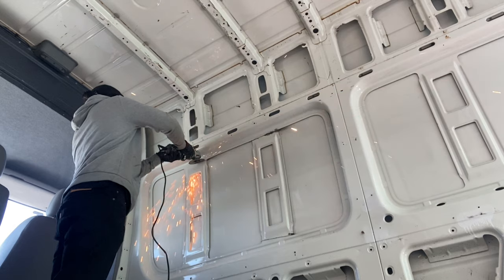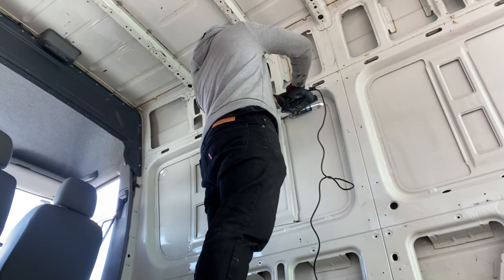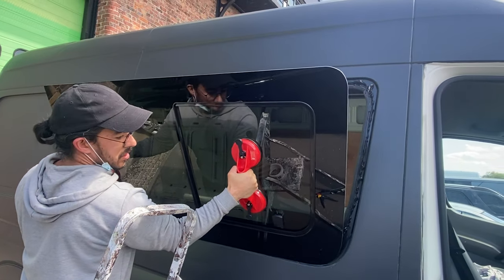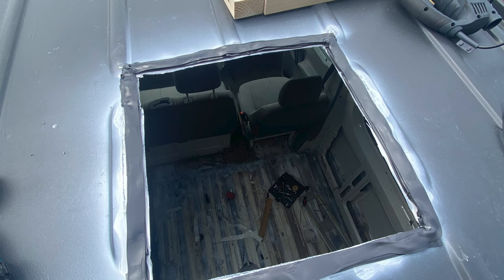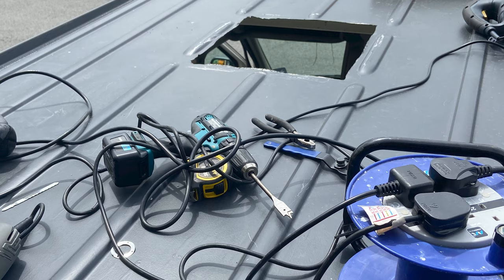I gave it another further coat since I scratched it installing the windows and cutting holes in the panels. So my next step was cutting out and installing three windows in the van to add light and ventilation - these come in easy-to-do kits, all you need is a jigsaw and an angle grinder to cut the holes out and then install them yourself. I then followed this up with installing a Maxi Fan Deluxe in the van and a Fiamma ceiling vent for extra ventilation. This is where I'm up to so far, so let me take you to the van and give you a tour.